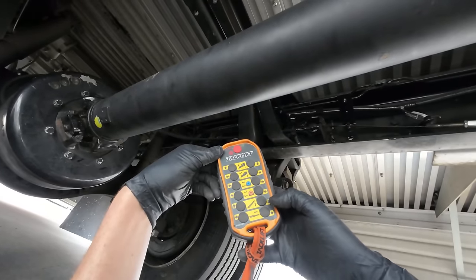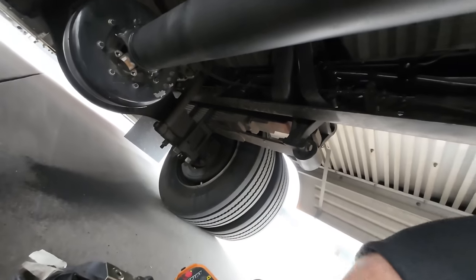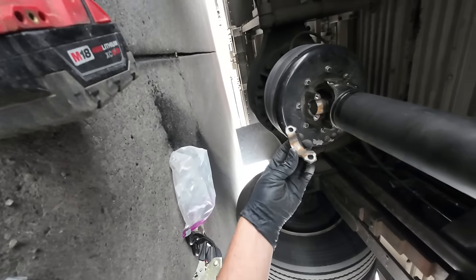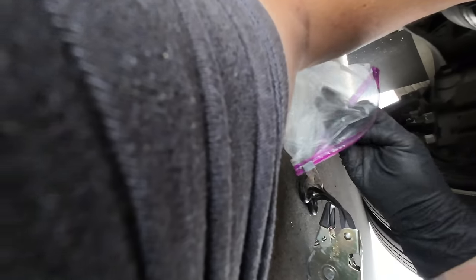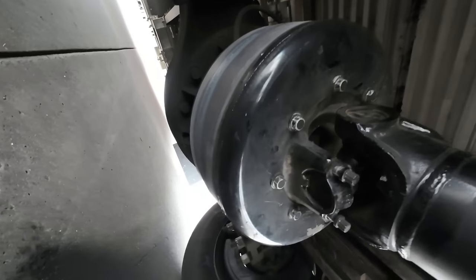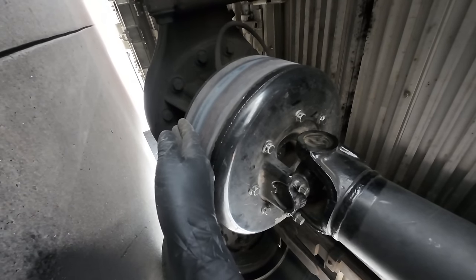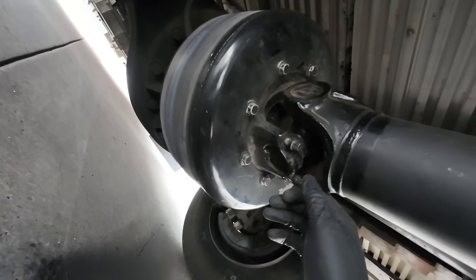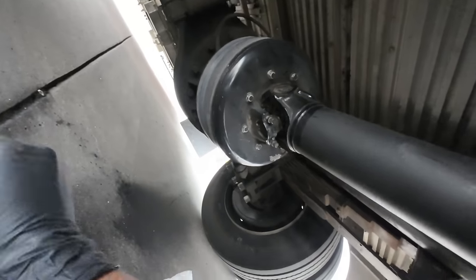Now we will bump it out. Look at all the brake dust come out of that, jeez. Throw the other cap on. Holy crap, look what I just noticed. Somebody definitely drove it a very long way with the parking brake on. So much that this is deformed like that. And it wasn't me towing it with the parking brake on, because look, it's cold. That's nuts.